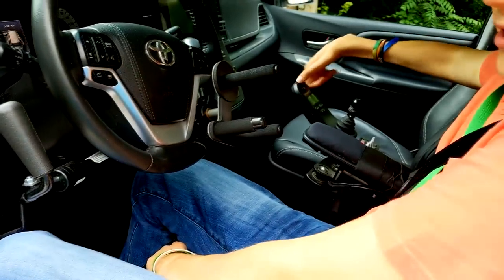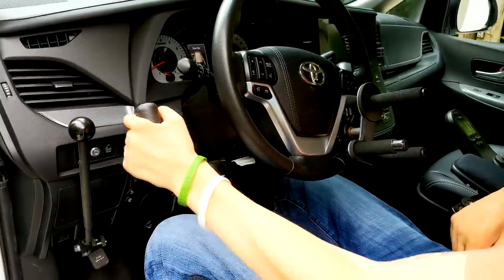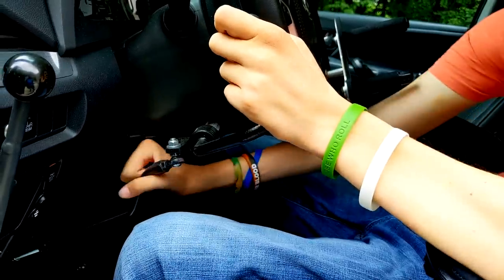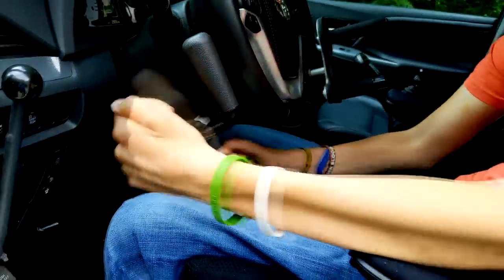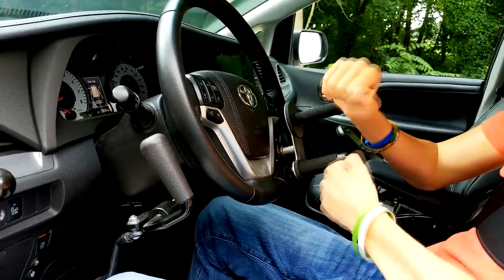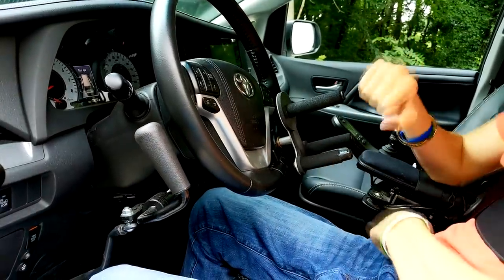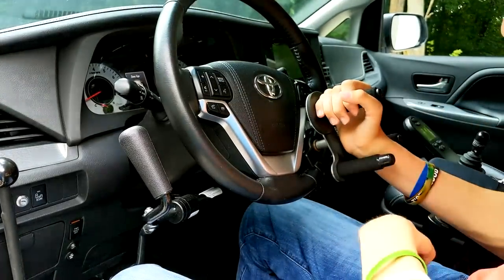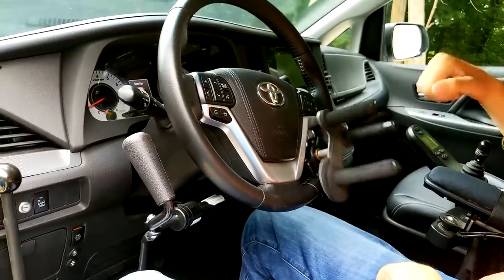I move the joystick out of the way and turn it off. Here are the hand controls. This is called a push rock hand control — you push it forward and that is the brake, and if you rock it back, that applies the gas. This push rock hand control has one bar connected to the brake, and the gas is connected electronically, initiated by pressing a button. Since I'm a quadriplegic, I don't have very good hand dexterity — just tenodesis. To control the steering wheel I use a tri-pin: I put my hand around it and my wrist between the two pins, which allows me to turn the wheel left and right on a spinner — basically a homemade fidget spinner.